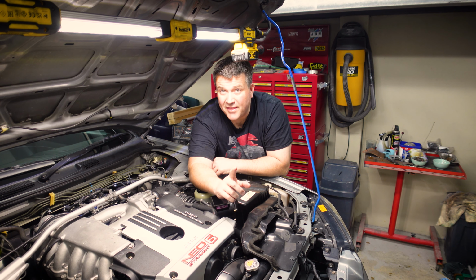Now, I don't know if this transmission has enough vacuum to pull in fluid. So I will try this first with a hose in here and a hose in here, and hopefully as stuff comes out here, it will get sucked in here. And if this increases at the speed that this decreases, we'll know we don't need any external pumps.